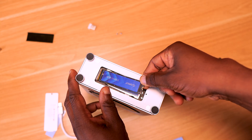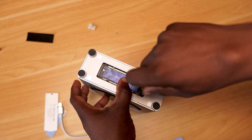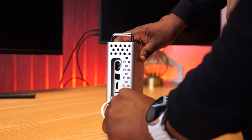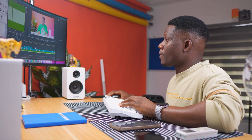That $94 price is a complete steal compared to Apple's pricing. Installing it was very straightforward: unscrew the base, align the SSD with the thermal frame it comes with, slot it in, screw the enclosure back, then connect both using the included connector cable — and you're done. The NVMe SSD supports up to 3000 megabytes per second, so you can edit 4K videos off the drive very fast, transfer large files in seconds without noticeable lag. It basically feels like internal storage, just far more affordable.